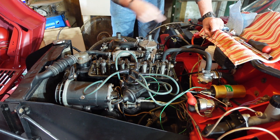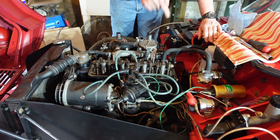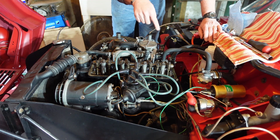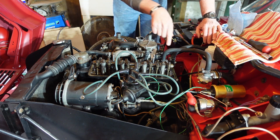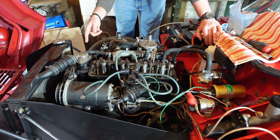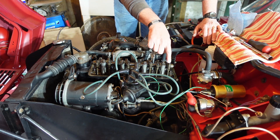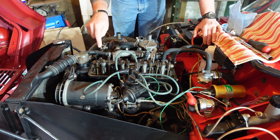You just start at the front and count one through eight. If I want to adjust one valve, I pick a valve that's at the very complete bottom of its stroke — in other words, the valve is completely open — and you can see that by rocking the engine. Then the corresponding valve that causes that to add up to nine is the one you can adjust. Right now it looks like number eight is pretty close to being completely compressed and fully down, so that tells me I can come over to number one and adjust the clearance there. I've got a big adjustable wrench since you can't really get a socket in there with the radiator in the way. I'll roll the motor a little bit, look for number eight to be fully compressed, find its essential rock point, and then go and adjust number one.